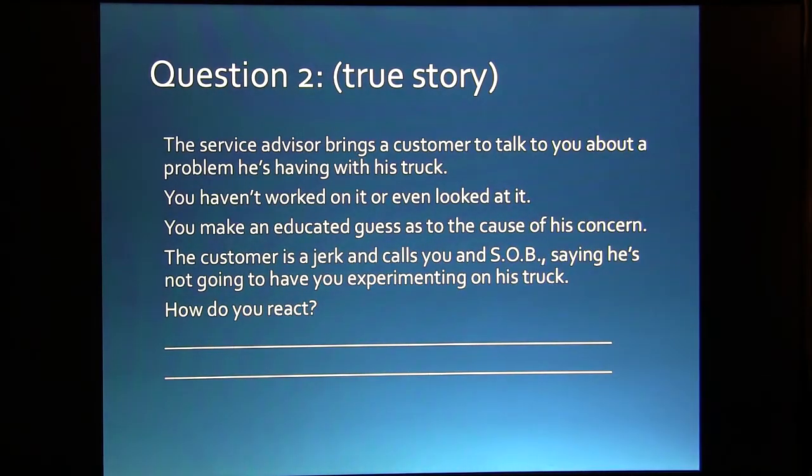What I told this guy, the service writer was standing there with him, and when that guy said what he said, and what he was asking me about, he says, my rear fuel tank fills up sometimes while I'm driving. And I says, okay. In other words, it pumps gas out of the front tank into the rear one. And I says, well, if I was going to guess at one of those, I would say it was the tank switching valve, because that's usually what's wrong with it.